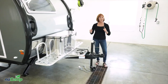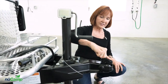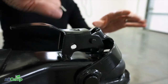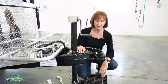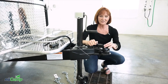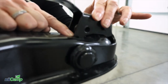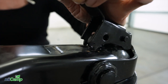Let's start right up front connecting the trailer to your tow vehicle. Lift this handle up and pull the collar back on the hitch. That allows you to back the vehicle up so that the ball is directly underneath. Crank your trailer down onto the ball, then replace the collar — lift up, push forward — and you can tell it's latched into place when the tabs go into the slot on the top of the coupler.